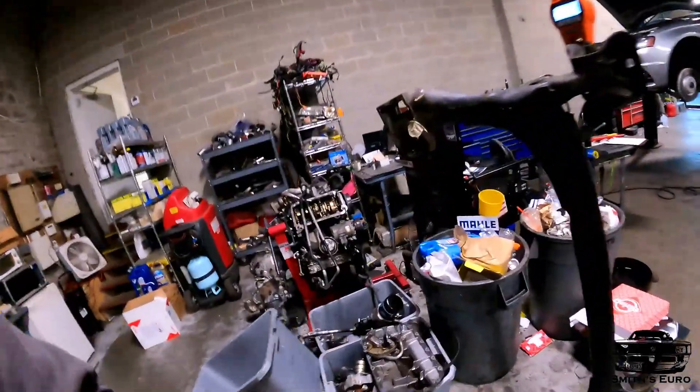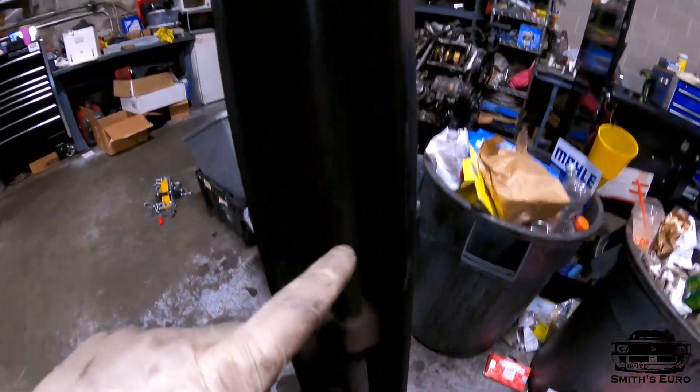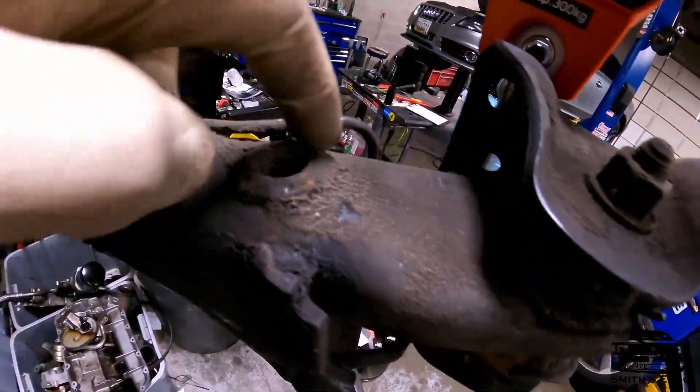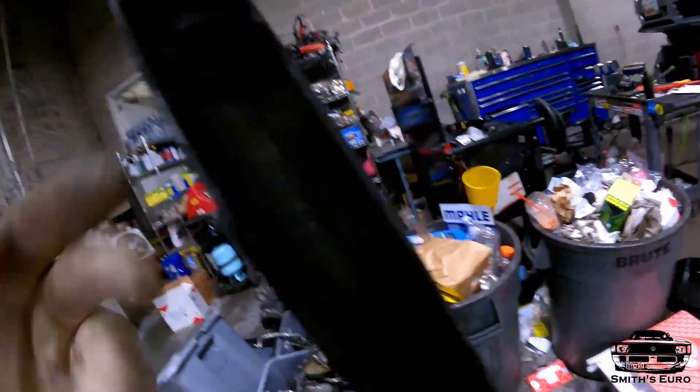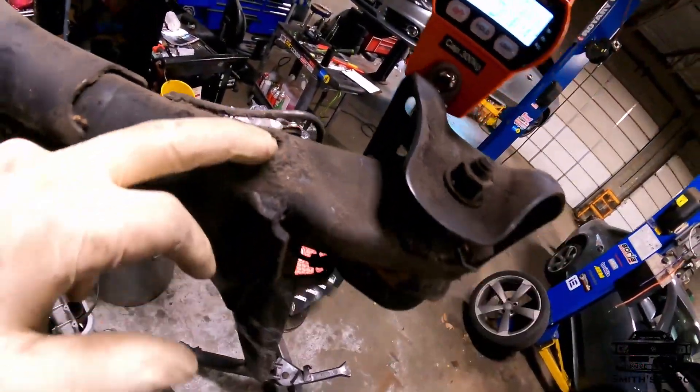What I've been thinking is that all these beams come with a torsion bar in the middle, which is basically a sway bar. You can see it goes all the way up through and is welded right here. I'm either going to plasma cut it out or take a hole saw and drill that hole on both sides. Theoretically after those are drilled out I should be able to pull this bar out — I think that'll be a pretty substantial piece of weight.